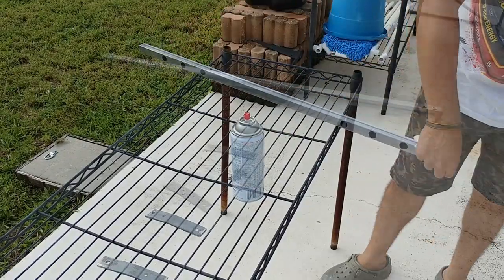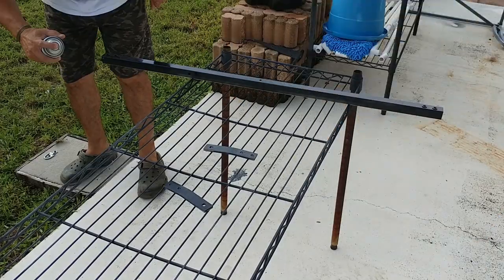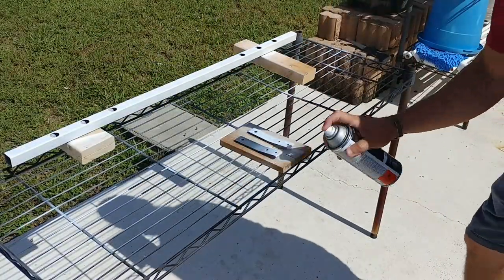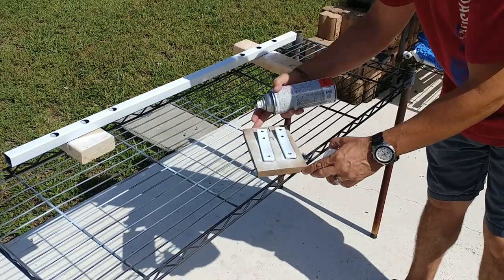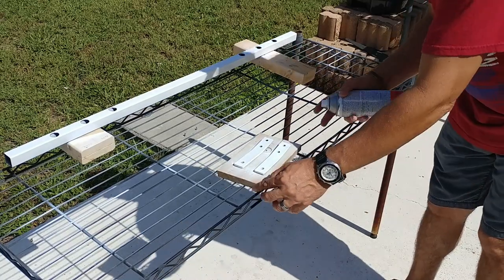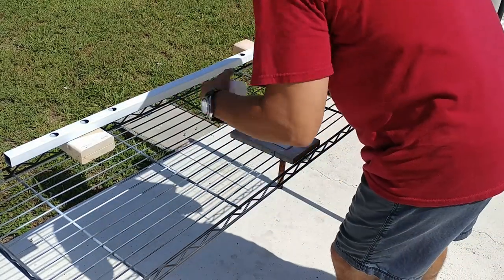The rain did not stop, so I got to work the next morning by giving the parts a good wipe down with alcohol, then a coat of rust-inhibiting primer followed by two coats of exterior white paint. That, my friends, was a disappointment — it looks grayish next to the truck. The Ford white is super white, white as snow. I strongly recommend finding a factory color match.